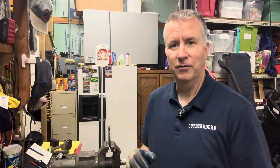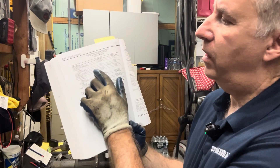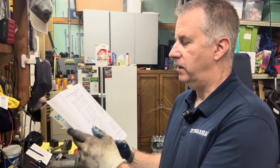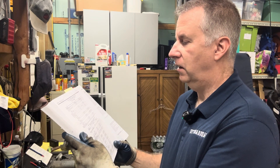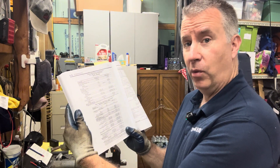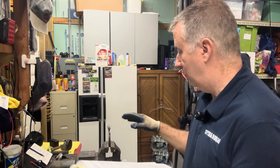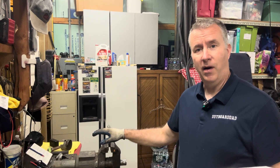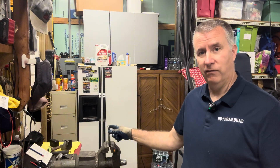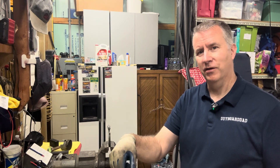Measure first and take it from there — measure twice, cut once. Just double checking the book: standard size is 3.501, and oversize is 0.015, which puts the bore size at 3.516. So there's your difference right there. Now we can go ahead and measure — making sure our micrometer is set up properly, and we'll get our dial bore gauge zeroed out at exactly 3.501. I am not a machine shop expert; I've learned how to do outboards. On the Mitutoyo, it says three-to-four inch range, so 3.5 falls right in there.